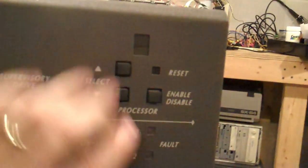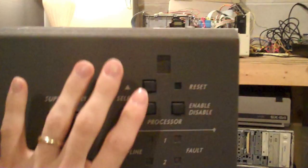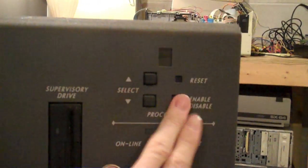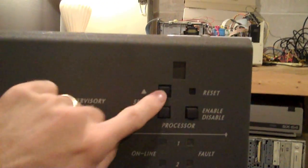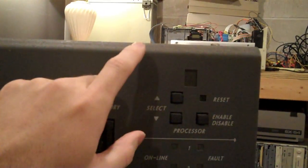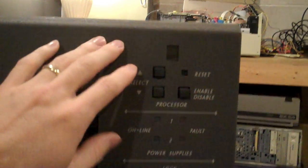Looking at the front interface to the multiplexer: if the system was running, by default the multiplexer was disabled, so there'd be a zero here — you would enable it, this would flip up to one which is the first group, and then you could cycle between them. They had a KVM cable on the back which would allow you to cycle through which machine you were talking to at a given time.